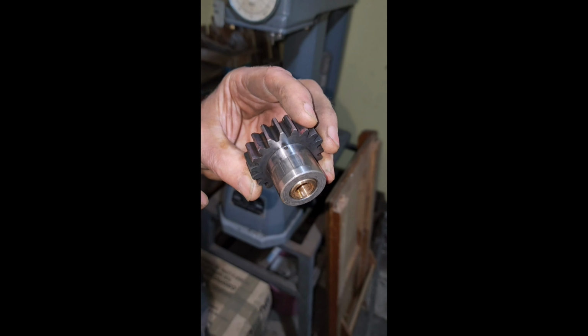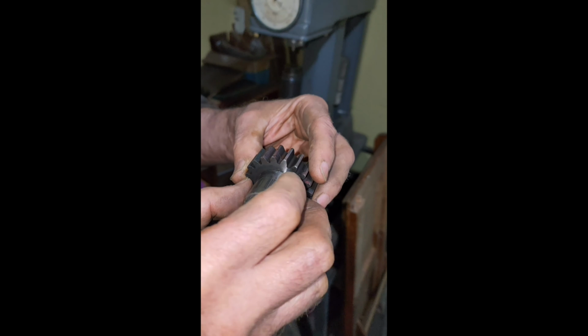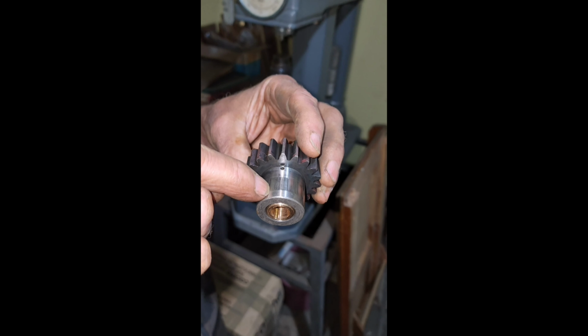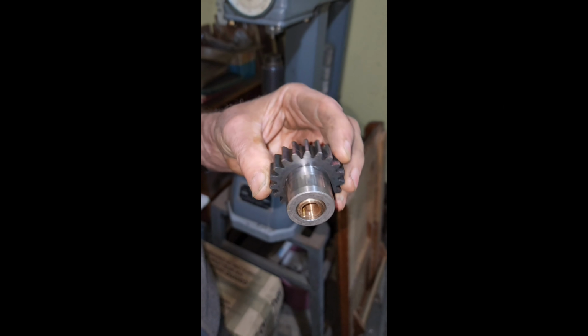It might be hard on there, but that doesn't mean anything. It's not deep enough. Fine if it had needle rollers running on it, good as gold. But not with the cams, not with that, where there's a line. All those cams. It's line pressure, isn't it? Yeah, it can't cope.